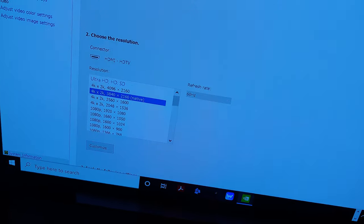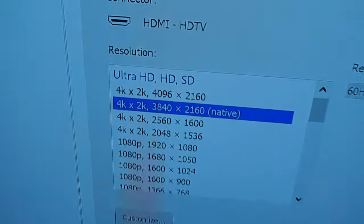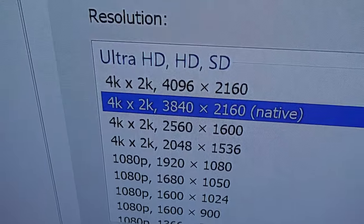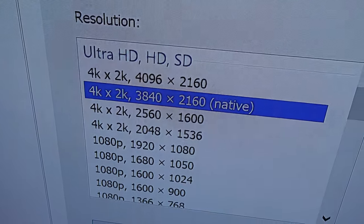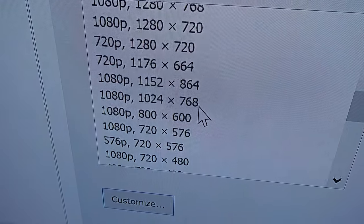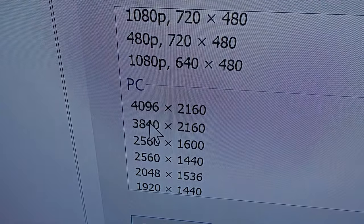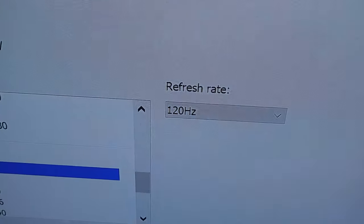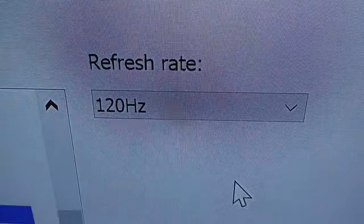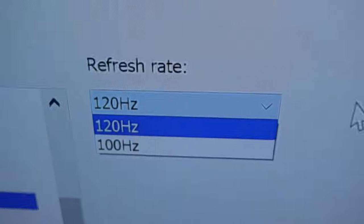Don't put your PC on carpet, but this is for testing purposes. When you go to display settings using a PC, you'll be met with two separate resolution options. You want to go down to 3840 by 2160 — the reason is the top 3840 by 2160 option maxes at 60Hz, while this one is 120Hz or 100Hz. Go ahead and apply that.